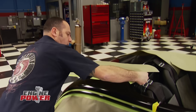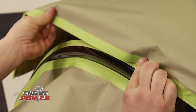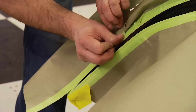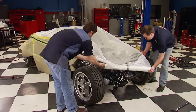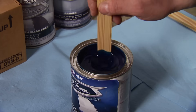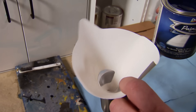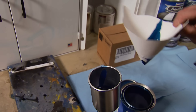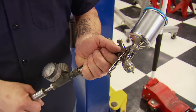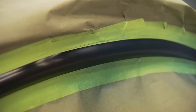We're in the home stretch and about to give Rattle Can Rod another splash of color. The car is masked off and we're putting a blue stripe using Duplicolor single-stage paint on the side to add some pizzazz to what is otherwise a flat black car. Using Duplicolor's Paint Shop Finish System in Midnight Blue — ready to spray right out of the can, no mixing, no reducing. Three light coats should give it a nice accent.